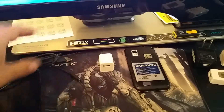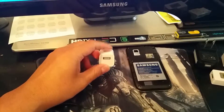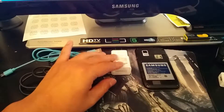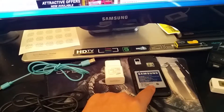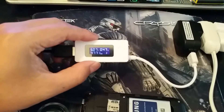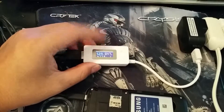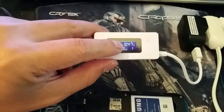If changing the cable still doesn't fix it, then most likely your battery or charger is bad. To tell which one, get a different charging device — another 1 amp charger — and do the same test. If it still doesn't charge in one hour, then you know the battery is bad. Let me show you the tools I use: this current and voltage detection tool, available on Amazon for about $10, the Sansonic brand. It shows you a readout of your voltage — here it says 5 volts.